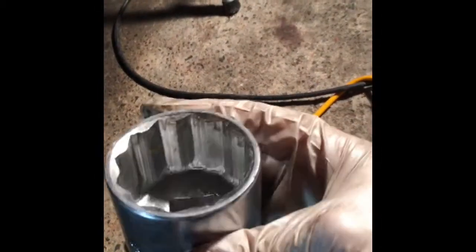It goes like so. Okay, you will need a very good breaker bar. What I have here is a barbell, you know, a weightlifting barbell. It's about 5 feet, and at the end of it I have a half-inch breaker bar attached to it. These sockets you will find in 3/4, you will not find them in 1/2. Since I have a 1/2 breaker bar, I bought a conversion from 1/2 to 3/4 that I just attached to the breaker bar here.